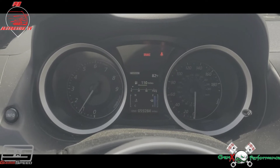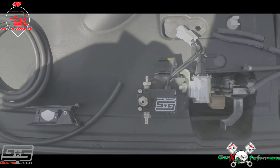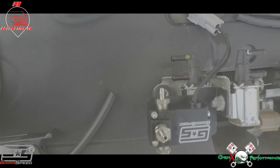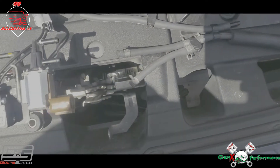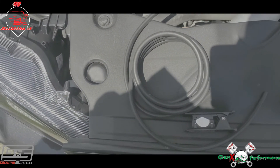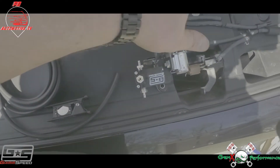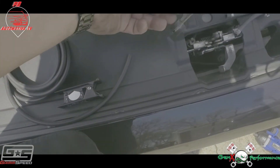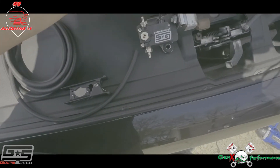Now we're going to go to installing the custom lines. If you're going to do the aftermarket hose install, you're going to need to disconnect the hoses from the black one here, and you can take this whole hose harness out. Then we have the hose they provided plus the hose cutter. Once you've got all this pulled out, we can remount the GrimSpeed in here. The black one will get hooked back up and your brown connector will go back to the GrimSpeed.